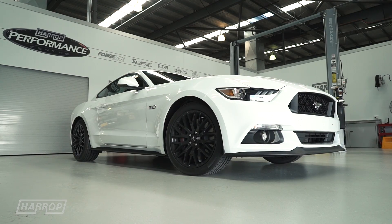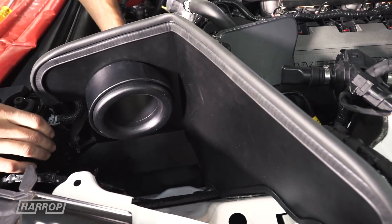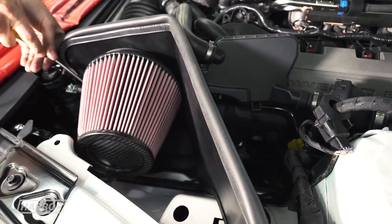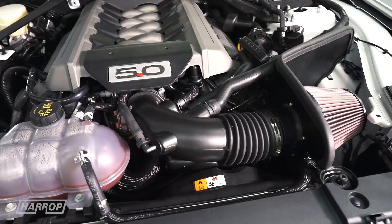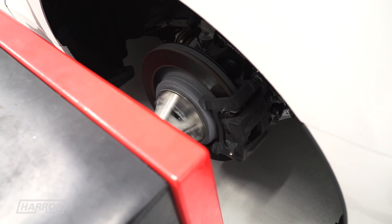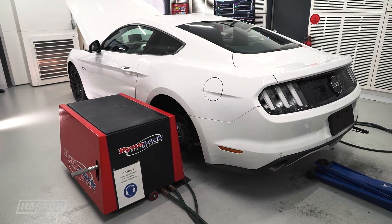Before bolting the supercharger to our white horse development car, we developed a new cold air intake for the Mustang featuring an open design and K&N pod filter to remove the factory air restrictor identified during our R&D testing. The K&N carbon cap filter is serviceable, providing high levels of filtration with reduced flow restriction, benefiting from greater air delivery to the bonnet-sealed air box. Without recalibration, the cold air intake change alone on the naturally aspirated Coyote yielded an extra 15 kilowatts or 20 horsepower, and a further 30 kilowatts or 40 horsepower with enhanced calibration, measured on our DynaPak hub dyno.